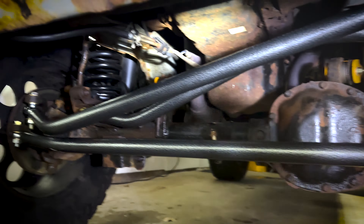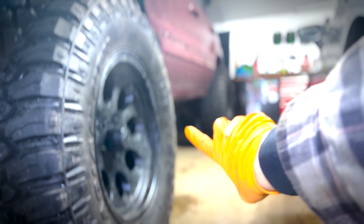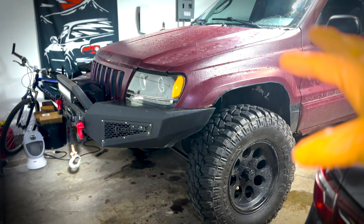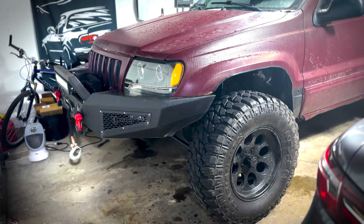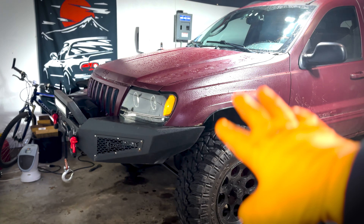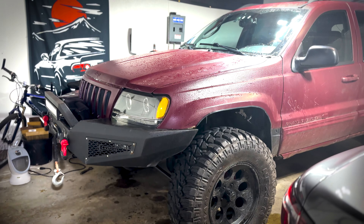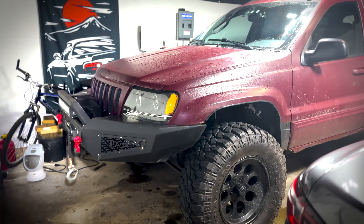A couple of notes before I end the video. If you're concerned about your toe being messed up, you can take a tape measure and measure the distance from the outside of your tire compared to the other side, then do the same on the rear side of the tire. If you have the same number, that means you don't have any toe in or out — you're pretty much dead straight. But you probably want just slightly toe-in, so you want the front measurement to have a slightly smaller number than the rear. Another thing to know is that in some states, using heim joints is actually illegal, so you may have to look that up on a per-state basis. In Ohio I never got an exact answer, but it comes down to the fact that it's not a DOT-approved steering link setup, which is why it could be considered illegal.